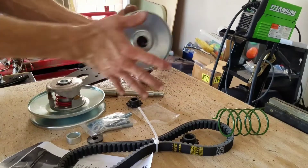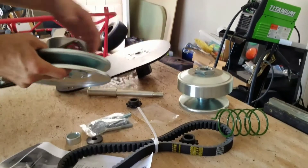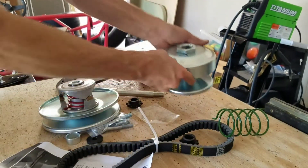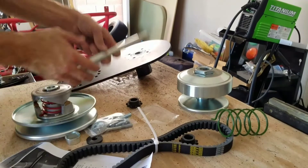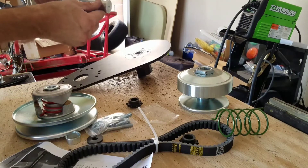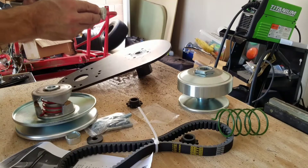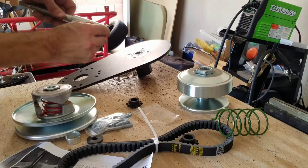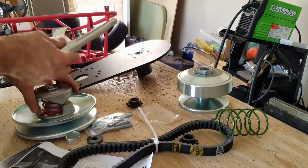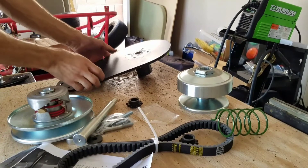Here's the drive gear — it opens up under RPM. Drive pulley, driven pulley. It's got a little laser-inscribed BlastLED driven pulley. The driven pulley shaft I ordered was three-quarter inch. Other torque converters have a little spring clip that holds it against the backing of the bearing, but this is actually just milled down with a big thick piece of metal as a shoulder to rest against the bearing.